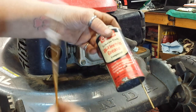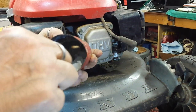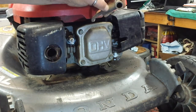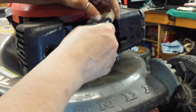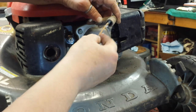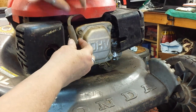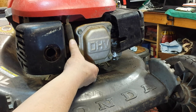I also like to add a little bit of dielectric grease — this one lost its aerosol propellant, so I just use a shop Q-tip to get a little bit on there. I place it just on the inside of the rubber boot. I don't try to get it into the electrode, because this will help prevent the spark from jumping and grounding out if there's a bad wire or a crack in the ceramic. Put that back on until you hear the positive click.